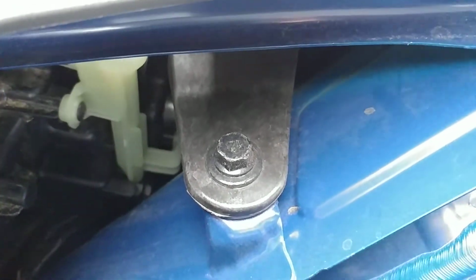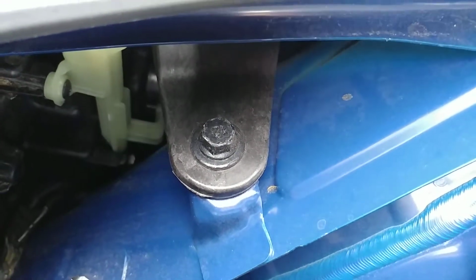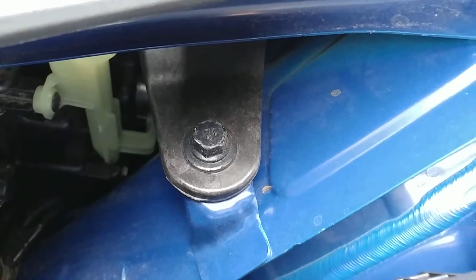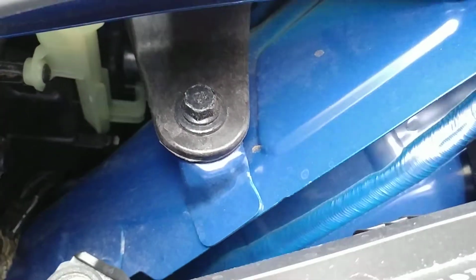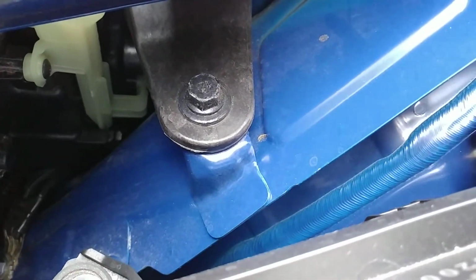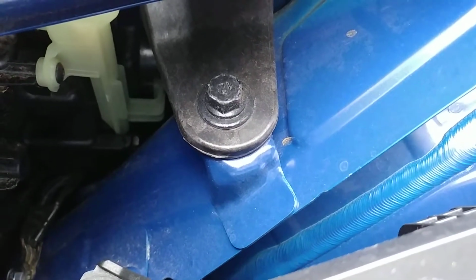See that plastic shaft right there? That is what your screwdriver is actually running through, and it's going to the base of the headlight area. And there's a little metal gear there, and the tip of that screwdriver is basically allowing you to adjust that gear, whether you want to go up or down. And you're probably going to go up, because the headlights were aimed too low from the factory on the low beam. There's also a metal nut/bolt on the back where that gear is, where you could also make the adjustment. But with the body structure of this car, I don't see how you can access that at all. And why would you want to make it complicated when a screwdriver takes 5 seconds?